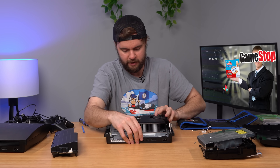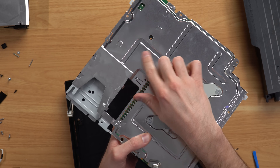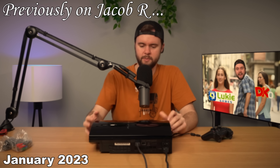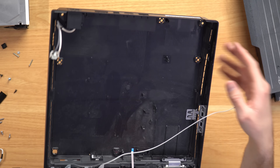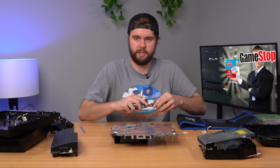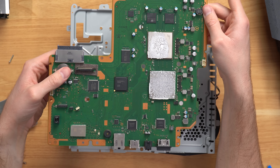Taking the entire board out of the chassis - the bottom almost looks like it has the same cleaning solution on it, with white specks. I almost wonder if some of the cleaning solution leaked into the case - there's even some almost liquid leakage inside where the card slots are. The bottom of the case has a layer of dust, so it was definitely not cleaned out. Now let's take the two clamps off and look at the thermal paste - that's the telltale sign of whether they refurbished it. And nope - sure enough they did not replace it. That's definitely the OEM paste, which doesn't look awful for how old it is, but clearly they should have replaced it.